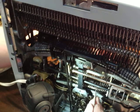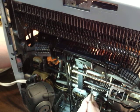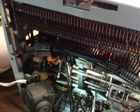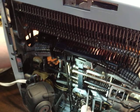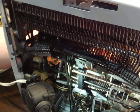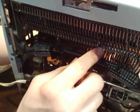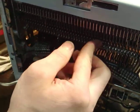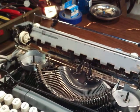Now it's in through that link circular. And then you bring that other half of that thing that you spread with the pin. The pin is now through the type bar, and then you put this other half over this side like that, and it connects the body up. Okay? So now that type bar is connected to its link. That's working here. And if we go up top, you can now see, hey, look at that type bar.